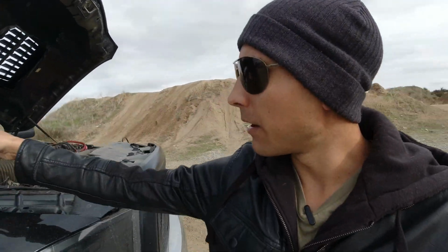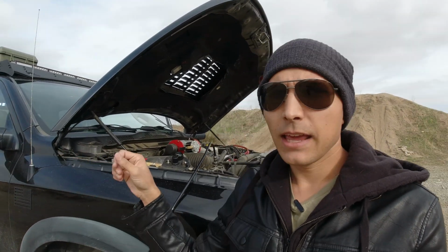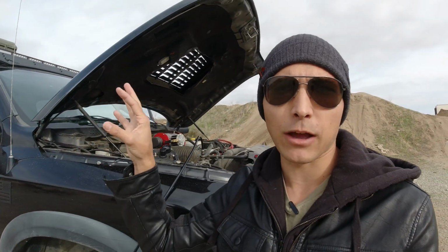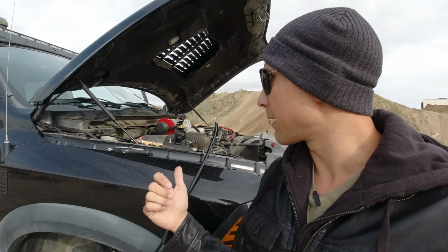Now, in a way, by doing this, in fact, I'm gonna close that valve. Once that air tank hits 150 PSI, just because the compressor shuts off doesn't mean airflow isn't going from the tank into the tires. So in the meantime, while I take measurements, I did close off the tank, to make sure that the pressure we built up in that tank is not gonna be bleeding into the tires while I'm taking measurements. So like I said, let me take measurements here.